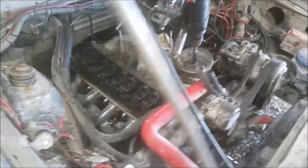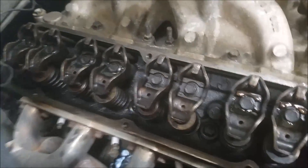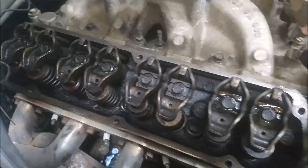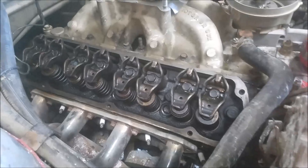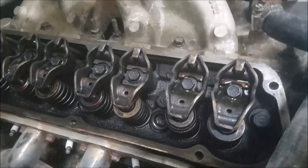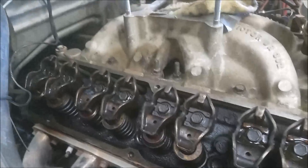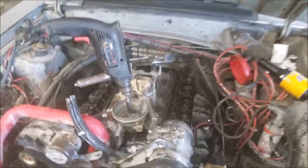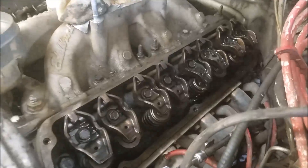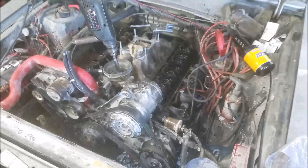Taking a quick look here — this is my reasoning as to why turning the engine always seems to help. As you can see, some rockers are lubricating really well but there are always a couple or three that just really don't want to lubricate unless I turn the engine a few times to get it to a different place in the crank rotation and thus a different valve train position. We're pumping up real good on this old engine — so far so good.